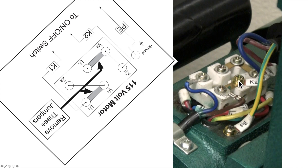Not only that, but they actually have K1 and K2 reversed. I'm not an electrician, but in 115 mode, one of those should be common and one should be hot. So technically, I think this means that in 115 mode you're actually switching and splitting the common wire instead of the hot wire, as you probably should. Bottom line is, once I move the jumper, I am now sending power across in the wrong direction, which it obviously has no business going — and that's where I smoked the motor.